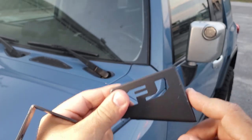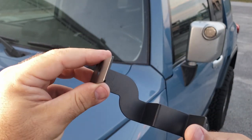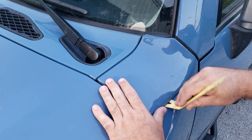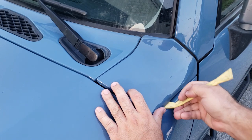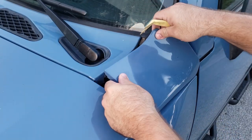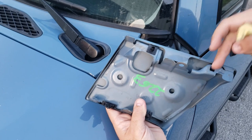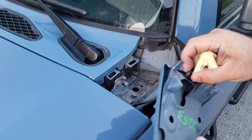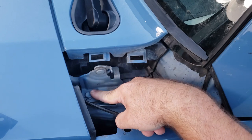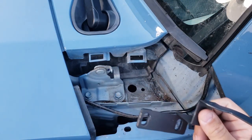What I didn't realize is that these are going to take a lot of modification. First, you're going to want to pop this off. Use a plastic tool or pry bars from Harbor Freight. You pry right here and it comes right off. These clips go right here and they're going to mount to these two bolts on the hood. Unbolt the hood — make sure it doesn't shift, and do this one at a time so you don't have to realign your hood.